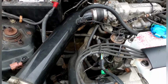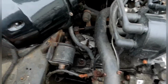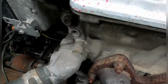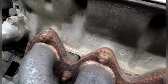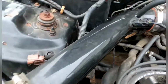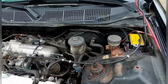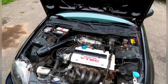We'll move some stuff around. It's got a small little coolant leak down there, so just this hose needs changed. Go over some grounds and some bolts. It's got this cheaper intake, so we'll change that out to a nice filter so this thing can actually breathe. Besides that, guys, it's a JDM H22A with the M2Y4 trans, and this is a '92. So it's got these jimmy-rigged mounts in it too that somebody had made up with the Prelude T-bracket, and you can see this side's on a stock mount with this piece. So he is going to order a set of mounts, and once he gets those mounts, we'll change them out after, but for now we will get this thing running good.